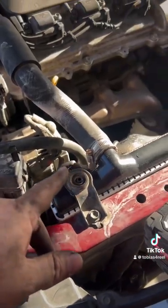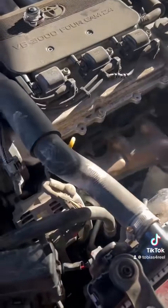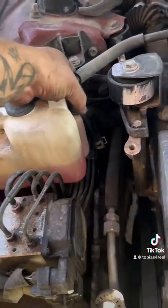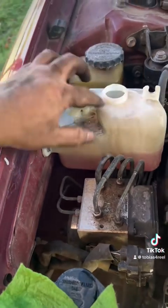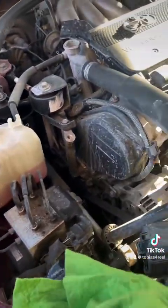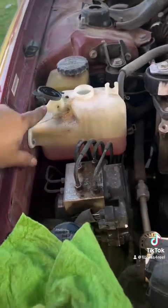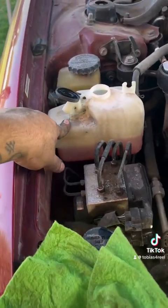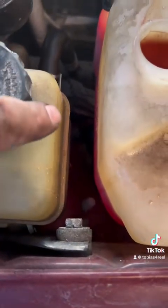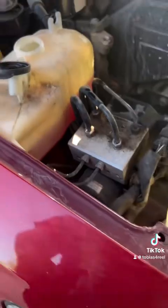All right, so after you got those in, no problem there. You can pull the one bolt here and take this line off, or you can suction this out. I like to get rid of all the old stuff and just put all brand new in there. Personal preference, but don't mix this old nasty stuff that could have been heated many times with brand new stuff. And one more bolt right down there. Just get your extension, both 10 millimeters, so pretty easy to come off.